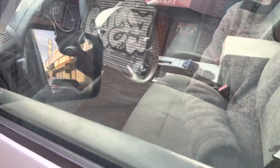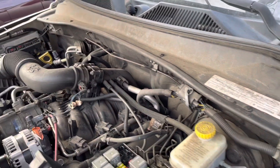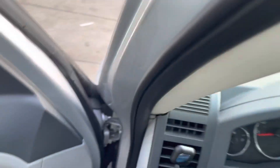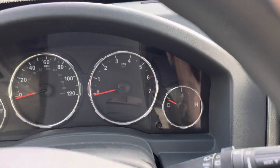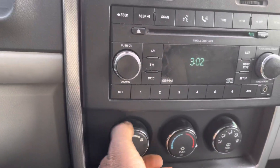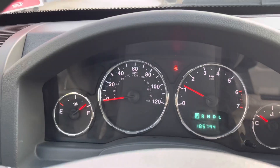What happened in this car is that when you come in here — you come in the car, you turn the door on, and you sit in the car. You push the door lock, nothing works. You push the unlock, nothing is going to work in this car. You turn the key on, the key starts, everything functions, but you don't have door lock or unlock. You may hear one door lock on the back, but nothing is working inside the car.